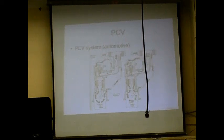But that turned out not to be true. The early 1960s was actually the dawn of the muscle car era. With the PCV in place, soon after we had things like the Camaro, the Hemi Cuda, the Pontiac GTO, the Shelby Mustang, the Firebird, the Stingray Corvette — all these things came out after the PCV came into place. The fact that it functions at mid-range, not at wide-open throttle and not at idle, means it really doesn't affect high performance at all. High performance is pretty much wide-open throttle positions, so it didn't affect them at all.